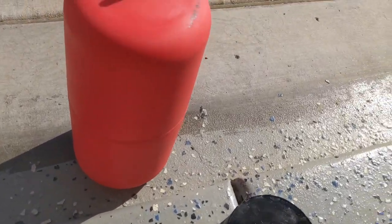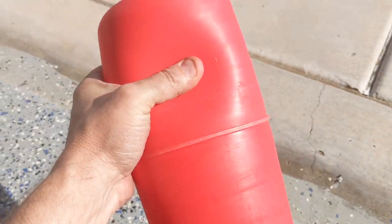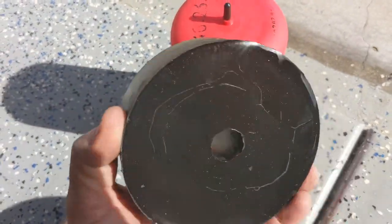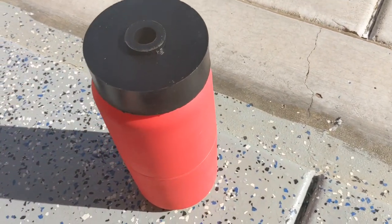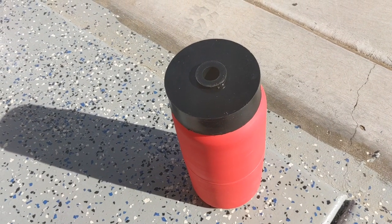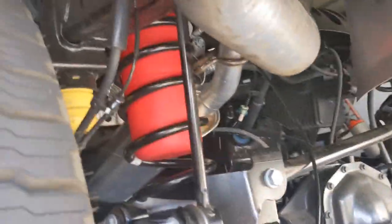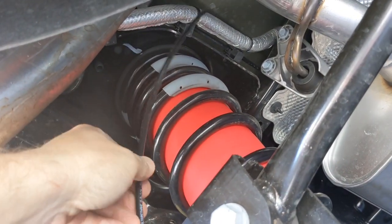The airbag has been sitting in the sun to make it nice and soft. The cap is still on so I can't squeeze the air out yet, but once you take the cap off it compresses pretty good. I have one spring in already. This little knob faces up — you get your line in through here and hook it up to the bag, so it sits on top of the bag. The whole assembly goes inside the spring. The instructions say to disassemble the rear suspension and pull the coil springs out to insert the bags, but you do not need to take your whole suspension apart — I'll show you why.